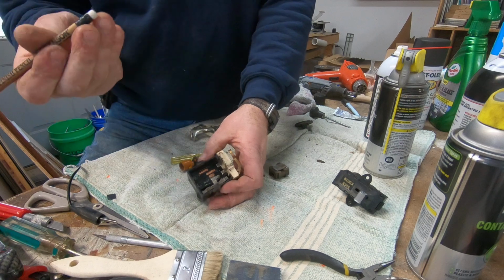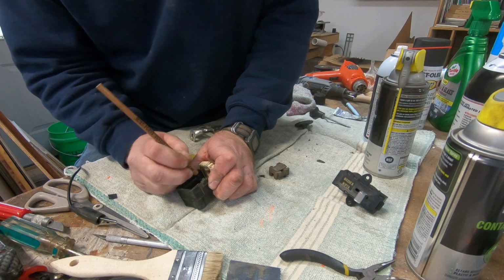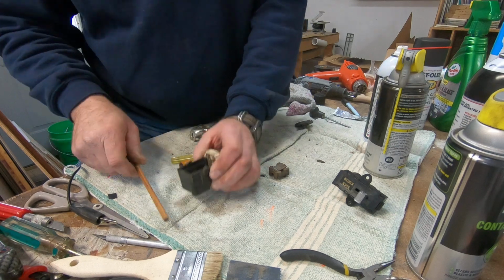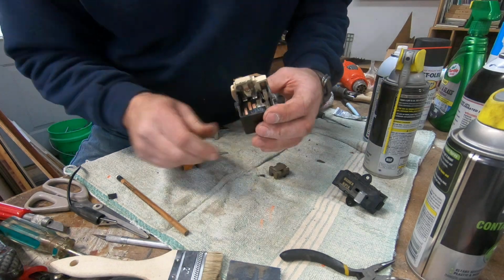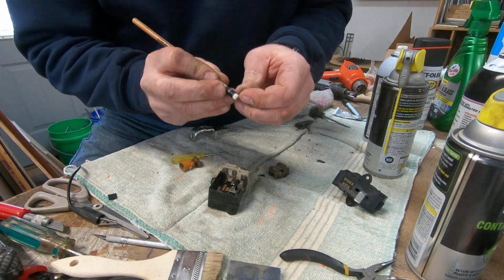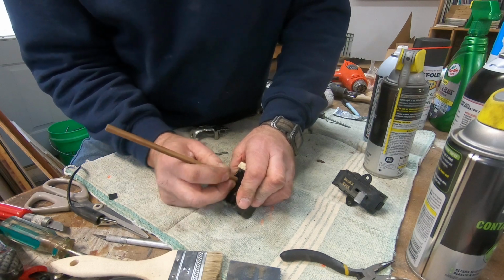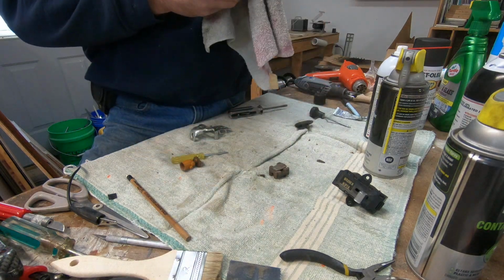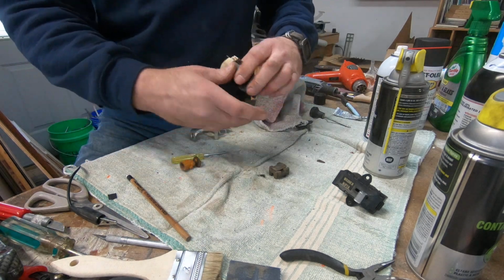I'm just going to take a pencil eraser that I have sitting here and scrub down the slides, anything copper, anything that looks like it's had something moving on it, just to clean that up. So we got it all clean. Most erasers have a little bit of abrasive in it to help them erase, so that's why I'll keep an eraser or a pencil around for some of these copper areas. I also have this Dremel here with a little brush if things need to get real medieval.